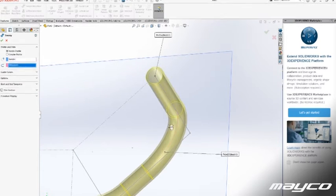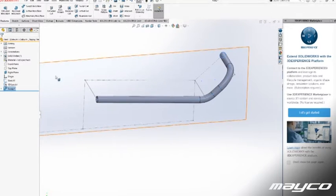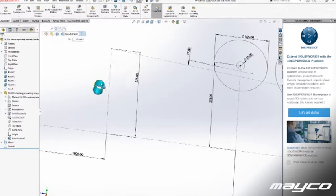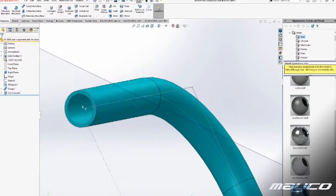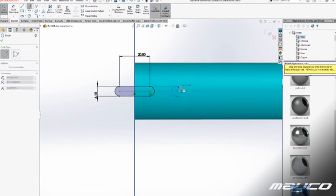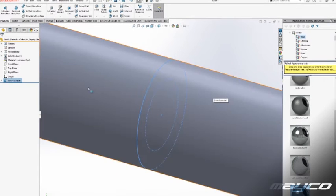It needs to be rigid enough so that it can take the torsional forces from the left and the right wheel driving over different bumps. So all in all, it is a little bit of figuring out what to do, how to proceed forward. One thing I did notice as well when I was working on it is that the rear crash support bar basically was a little bit in the way with the motor. If the motor goes up, then it quite quickly touches the battery pack and also the rear bar that goes across. So what I'm trying to do is raise that bar up.